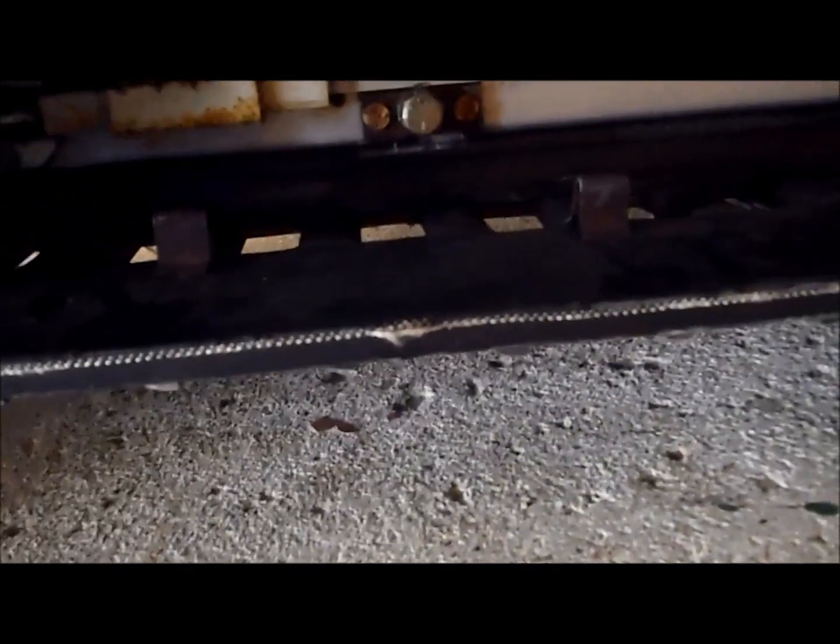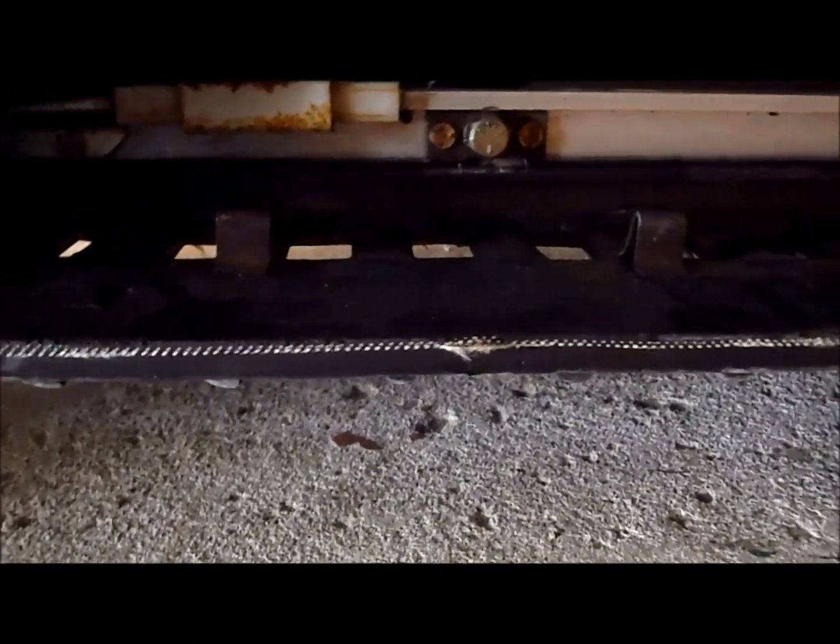Now the track — you'll see it's going to be clearing the side. Well, you can't really see it, it's a black slider. We'll go to the other side. With this, you can kind of see the clearance between the bottom of the slider and the track. At its lowest point, at its greatest clearance between the slider and the track, you should have about 13mm clearance — so 1.3cm. That's just a little bit more than my pinky, and that's about 2cm right there. So we're going to adjust it.